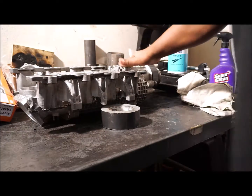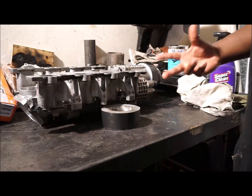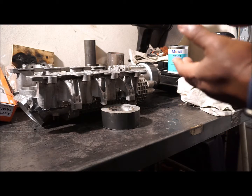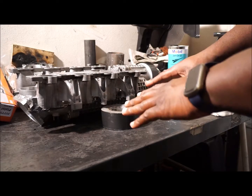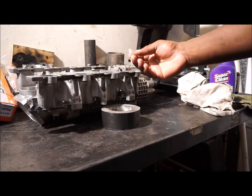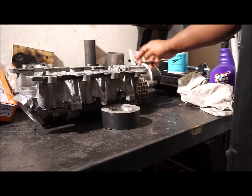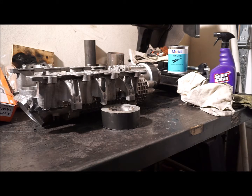Keep in mind when you put the new oil in, it's 150 milliliters total that you inject in there. If it's mounted on the motor or on a perfectly flat and level surface and you're using a syringe, inject the oil until it literally drips out - once it starts to drip, stop. When it's mounted to an engine on a level surface, that's right at the fill point. 150ml is the spec when it's upright.